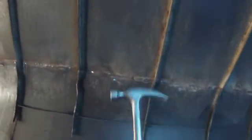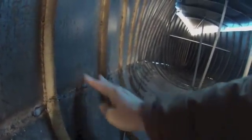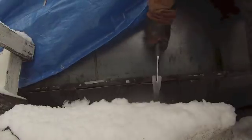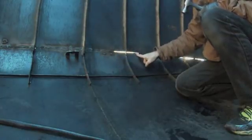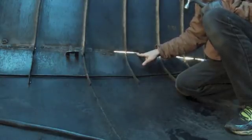I've been working along the seam between the wall and the floor and all I've been doing is using a hammer to move the metal around. Here's a shot of how the floor and wall seam is going and how they're matching up. Here's what it looks like from the outside — it's relatively flush here and here. I'm going to weld there and then after it's heated up I'll hammer.